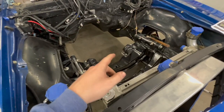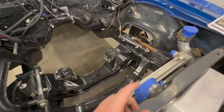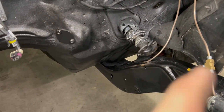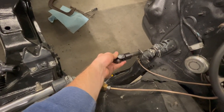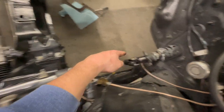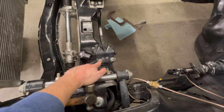The paint is completely dry so we're gonna put that rack and pinion in the mount and all that stuff in there for the last time. Hopefully it is mounted in there looking spicy. We're gonna set up the steering shafts - gonna go ahead and cut that piece off right there, and then this is gonna slide inside of that tube. That's what we'll weld on, and then that will go down to that, hopefully not hitting my LS swap mount.